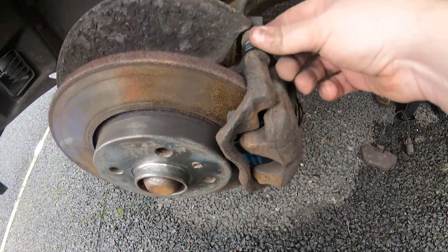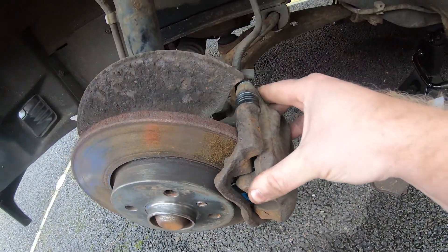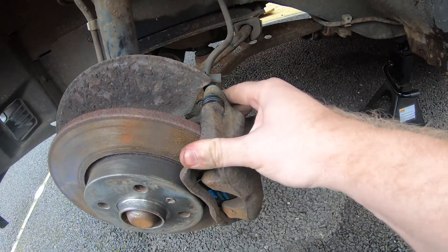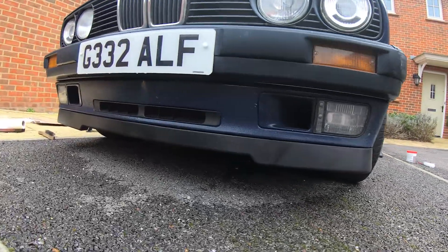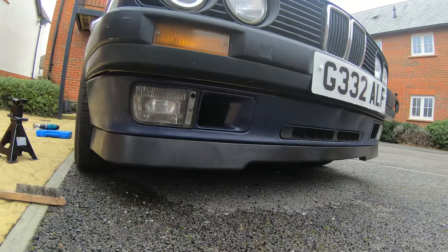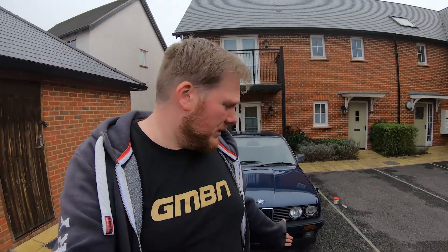All the bolts are in, all tightened up. There's a bit of movement back and forth on the sliders because we haven't pushed the piston out into the pads yet. So we're done working on the Beamer — we've done the front brakes, new sliders in the calipers, gave it all a wire brush, a bit of copper slip before putting the wheels on, and we've done the front lip down at the front. 60 quid for this eBay lip — quite impressed really for 60 quid. Thanks for joining me today guys. Next time we might be doing the bumper — I've got the part inside the flat, girlfriend loves these things laying around. If you enjoyed the video and you made it this far, make sure you drop a comment down below or a like, and subscribe if you haven't already. Catch you next time guys.